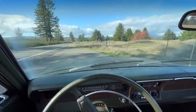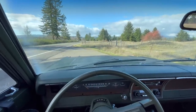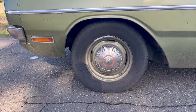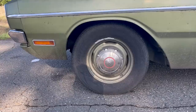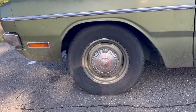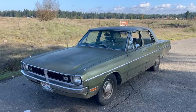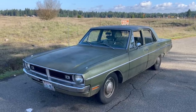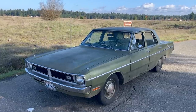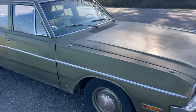I'm looking over the same kind of hood that my '71 Demon has, so all of a sudden when I hit the brakes there, I thought I needed to hit a clutch too. If you suspect you have a sticky brake — one that's either dragging for various bad reasons or one that you've adjusted too tightly — it's easy to figure out. Take the car for a drive, park it, and feel all the wheels for heat. I'm not feeling any here, so that's a good sign. This is Hazel, my coworker at Rocket Restoration's Laura Lee's reliable daily driver for the last 18 years, mostly. Laura Lee is the second owner of this car, just like I'm the second owner of my Demon.